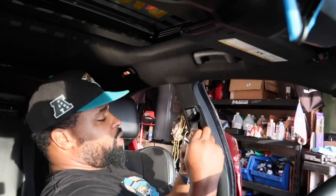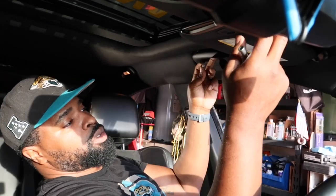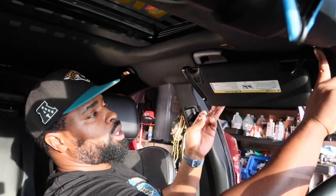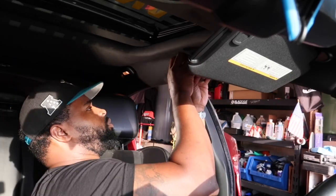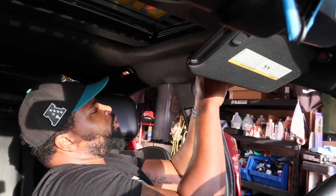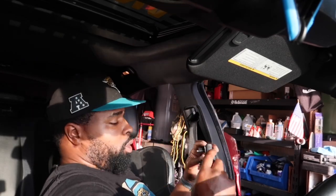So now we're going to go to the cabin. All right, guys, so I was able to get a different angle. This is a T30 bit star screw. You need a T20 for the trunk, and you need a T30 for these handles, and that's it. The screws up here are T20 as well, for the window visors. I just close them so they'll stay in there, they won't fall out. It's a little spring in there.